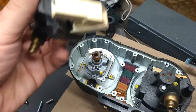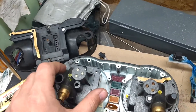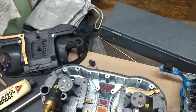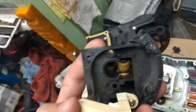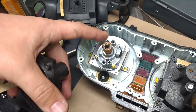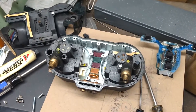Getting the backing plate back onto the tach is a two-handed job, so I can't illustrate it with the phone in hand. Basically, have both units out of the housing and then slot them together. It helps to actuate the worm drive with a small flathead screwdriver — a lot of times you can get them to drop back together. There are a couple of locating pins that line up with casting holes in the back of the tach. From there it's just reassembly — put the two large flatheads in and reassemble as per the instructions on CatDash.